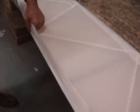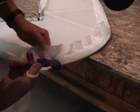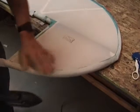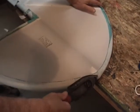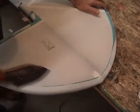We'll come all the way around and pull this loose around the entire perimeter. We'll go ahead and continue cutting around this. Once we get through, we'll move to the next step in the process. We've got our perimeter trimmed — you can see this is a little loose fit. What we're going to do now is just take our iron and just roll it right up around the radius. You can see how nicely that all starts laying right back in there. We're going to go around the entire perimeter like this. As you can see, that's almost like a finished edge there right now. We'll go all the way around and then demonstrate the gluing and wiping one more time, and that will pretty well wrap it up for this panel.